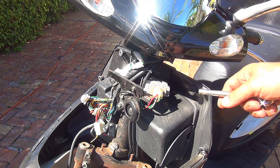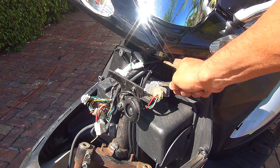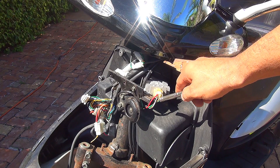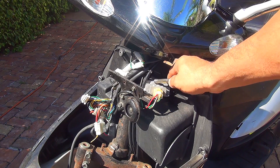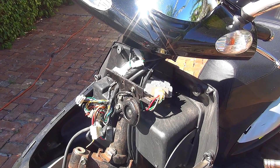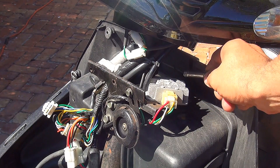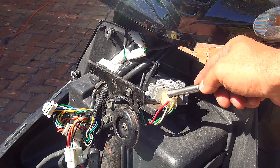Right after you open up the front part of your scooter you are going to see lots of wiring, and on the right side you will see the rectifier. This is the Regulator Rectifier that gets power from the stator magneto alternator, and the wires are rectified from AC to DC to recharge your battery and run the lights. Note that you can have a larger rectifier, a smaller rectifier, or a full bridge rectifier — so before you order, open your scooter and check what size rectifier you have.